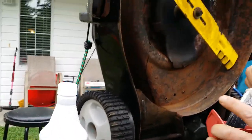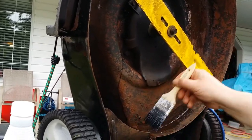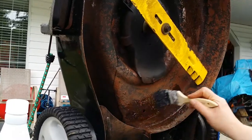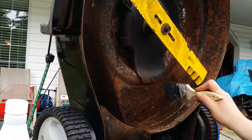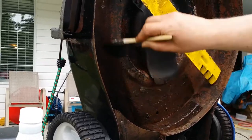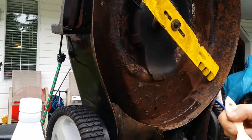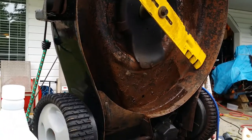What I'm doing right now is just taking the brush and actually applying it onto all the metal. You have to paint after — I think it's 72 hours — there has to be a coating on here, otherwise it'll start to process all over again and start rusting. Basically what we're going to do is coat the whole underneath of this to protect it from rust, and then we're going to put an undercoating on.